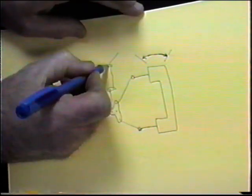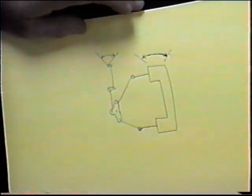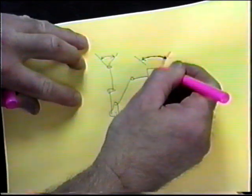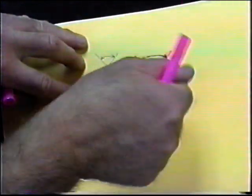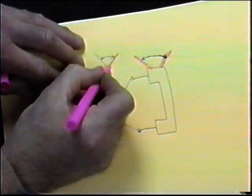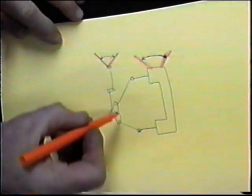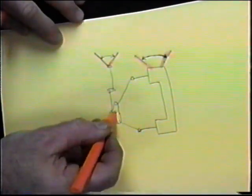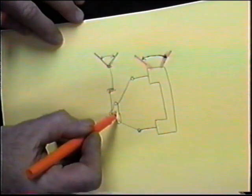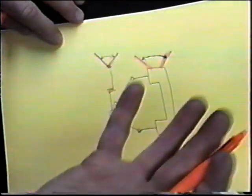And out at this end, you have an amount of travel of the control system, flaps and elevators, of course. And what it means is you can tailor it. Now, you can use this amount of wrist action, and you could probably measure that on a gauge, to give you this amount of throw at the elevators. Now the problem is, anytime you tinker with any of these ratios, this comes into play as being something you've left out of the adjustment.